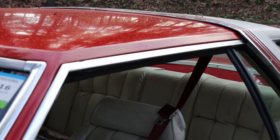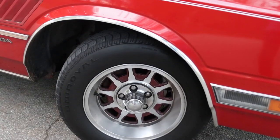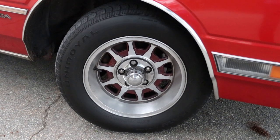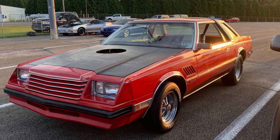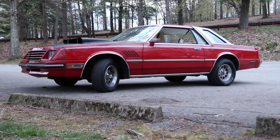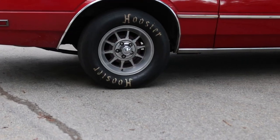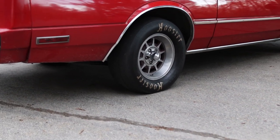The chrome stuff is all original — it took a lot of buffing and polishing. The wheels are original, but not original to this car. This is the set I had on my old '83 Cordoba, but they actually are factory 15x7 aluminum wheels that belong on this car. I had Cragers on it for a little while, got tired of them. Me and my buddy put super stock springs on the back — they're originally for a max wedge car, like a '65, '66 Plymouth, but they sold adapters for the J-body to extend it. So it's sitting on Mopar super stock springs for an automatic car — a 3,400-pound car. It raised the rear end a good bit and it helped at the track too, because it shoves those tires right into the ground. I don't have any issues with traction.